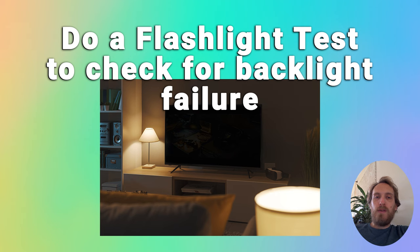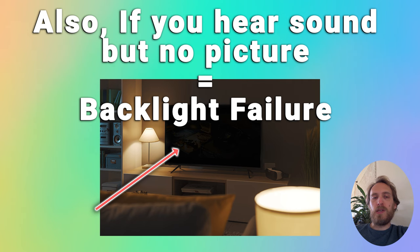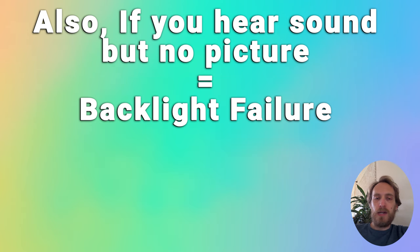To make sure your TV is really not turning on, follow your normal process of switching on the TV, then get right up close to the screen and point the light of your phone at the screen. Try changing the channels with your remote or going into the menu and see if you can see some very faint images on the TV screen. If you can, that means the backlight has failed — it's very easy to replace yourself and you can check out the linked article below for steps on how to do this.